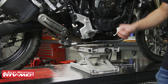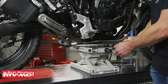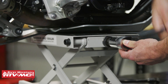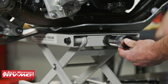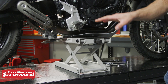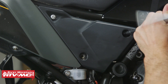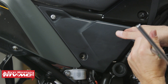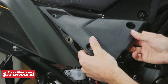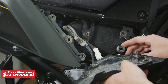To start out we need to unload that rear shock. I've got this drag specialties scissor jack — it's tied down just to be safe, but whatever you use make sure the bike is secure. We're just going until the back wheel almost comes off the ground, and then from here we can remove two plastic covers on each side. We're using an 8 millimeter T handle for that. We also have that tab and grommet you need to release.